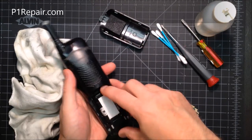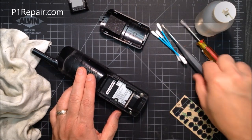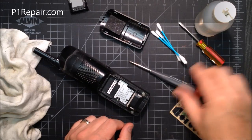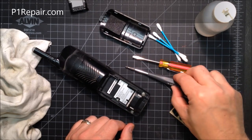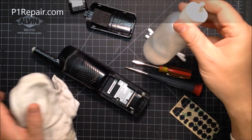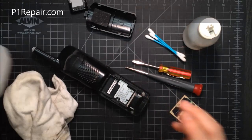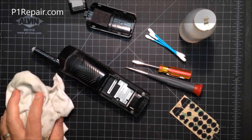To start, take the battery cover off and remove the battery. There are two screws down here. You'll need a flathead screwdriver, a Phillips screwdriver, and a cleaning rag, plus some rubbing alcohol — 91% is best. If you only have 70% that's okay, but do not use 50%.